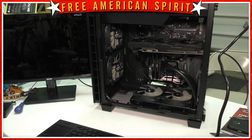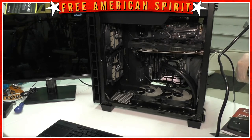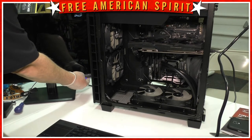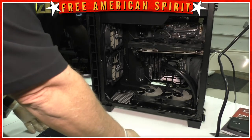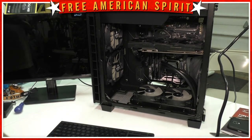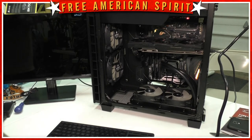Everything is hooked up. I ran a power cord but haven't turned it on yet. I've placed the monitor nearby and connected it to the HDMI port on the graphics card — not the motherboard's HDMI. I'll plug the USB receiver for the keyboard into the back panel. First, turn on the monitor power to confirm it has juice — it's on, showing no signal. Turning on the keyboard. Now turning on the main power switch to the computer. Lights are on on the motherboard, but I haven't pressed the start button yet. Here's the big drum roll — is it going to fire up?